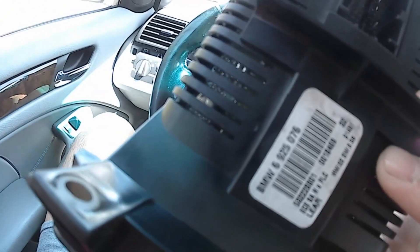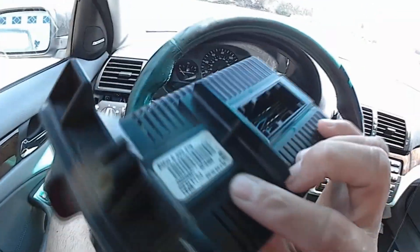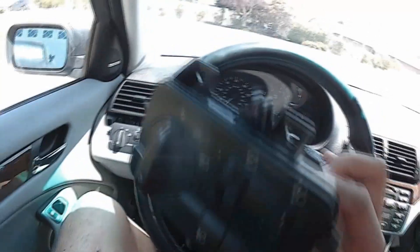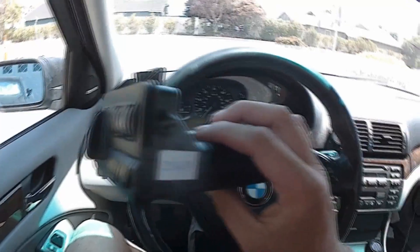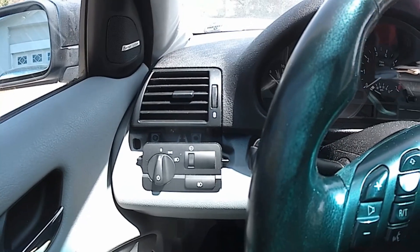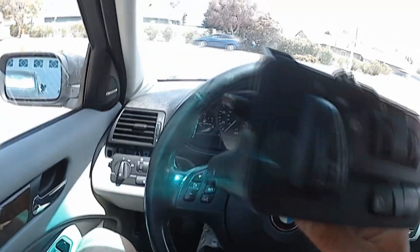Something important to remember when you do this — there are software levels on this. This is software version 3.56. Always go higher than what your stock one is. I initially ordered one that was a 1.0 and it didn't have the functions or recognize many things in the car because the car was thinking it was too old. So this is the second time I'm doing this. This one is a 3.01, which most O2s and up are higher than 1.0, and this replacement is a 3.56 — this is compatible. At least go higher.